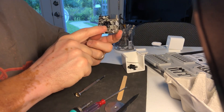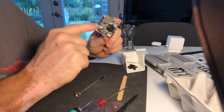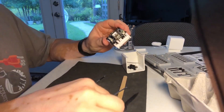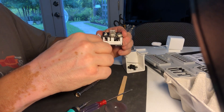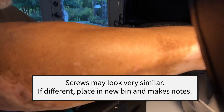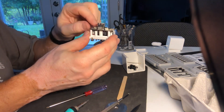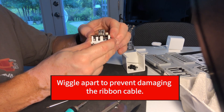The moisture is not on the outside of the optics. You could have some moisture inside the lens assembly, but where I found the moisture on this last one was between the sensor and the lens assembly. We've got a couple of ribbon cables to contend with. Take this ribbon cable and very carefully lift up on that, then pull it out. Remove the two screws. Be careful about just pulling the board away too quickly — there's one more ribbon cable underneath that we're about to get access to.